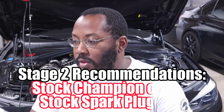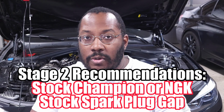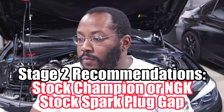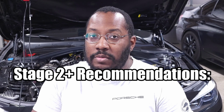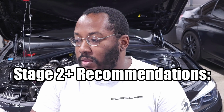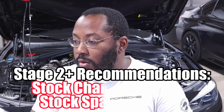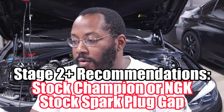So that is the NGK 94201 or Champion 9425 for Gen 1 cars, and then the NGK 96206 for a Gen 2 B58. Now, for those of us that have Gen 1s, we have the Stage 2 Plus version that allows us to put a high-pressure fuel pump on our car and make even more power with the upgraded fuel system. So if you're running Stage 2 Plus, I recommend the OEM spark plugs. So that's NGK 94201, and Champion 9425.